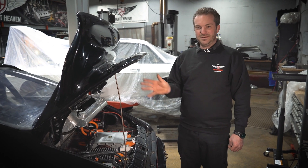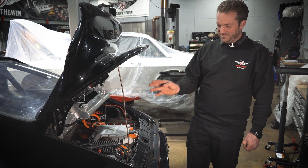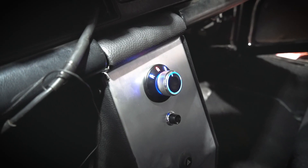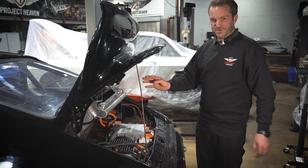You can't just disable random inputs you don't like the look of — they need to be reading correctly. And if all those conditions are met and everything's within parameters, the light on the BMS will go green, and that then allows the gear selector knob in the centre of the car to light up. But if there's any problem, it will go red and it'll stop you from putting it in drive.